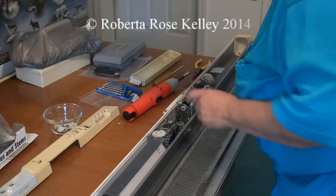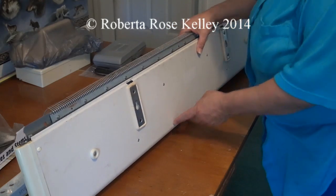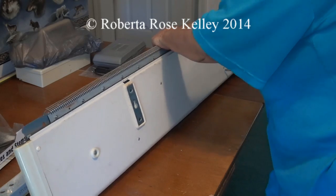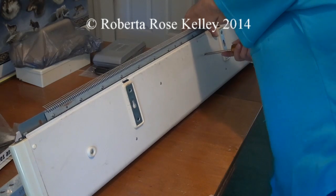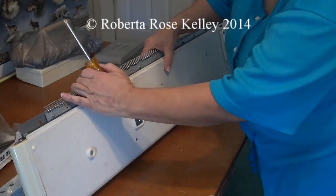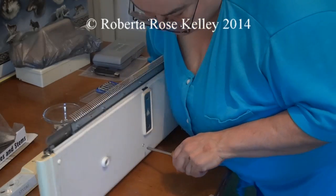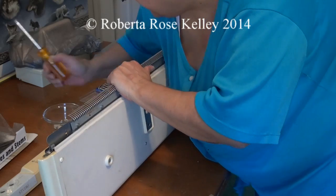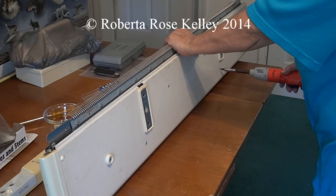As I look at that screw down there — well that screw's not here. But I do have one, two, three, four screws here I have to take off to get the bed off. First I just take the hand one to loosen up the screws, then I will take my electric screwdriver to get them out completely. The little screws for the card reader I put in my tray on the right, and these four screws I'm going to put in the left part of the tray.